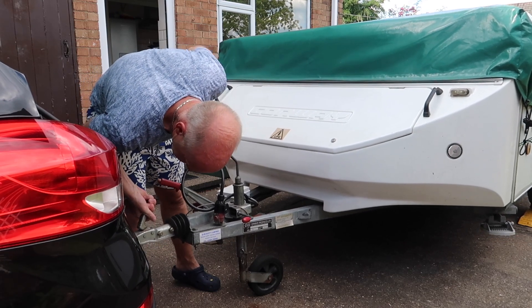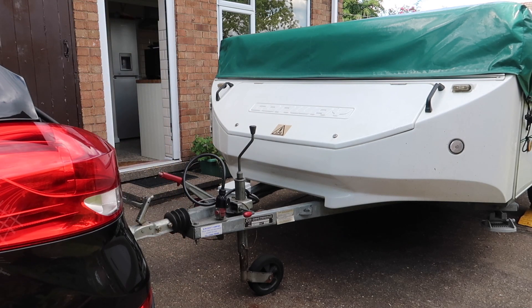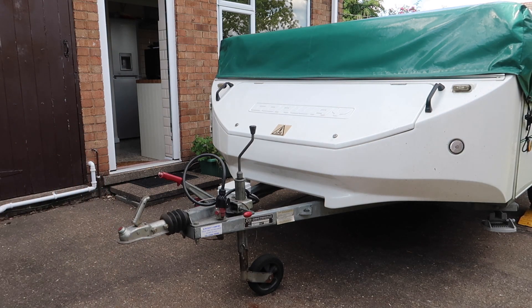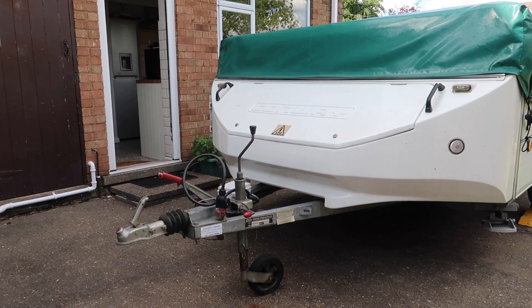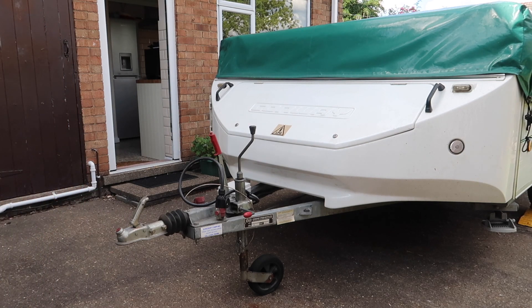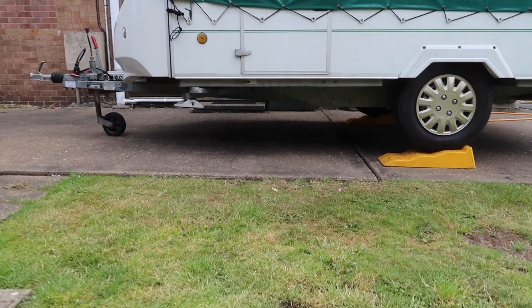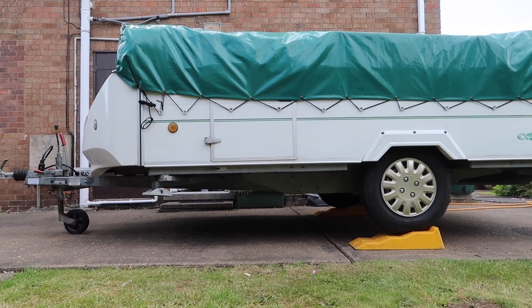As you can see, the trailer stays where it is — that's reversing onto a ramp. It's not going to go backwards because it's got to go up a ramp. I'll move the car out of the way. To site the caravan, I can't pull it forward, but what I need to do now is put some extra energy into the energy store so it can't move in any windy conditions. The handbrake needs to be fully up, and in that position the handbrake is fully on — and it will not go down the ramp.